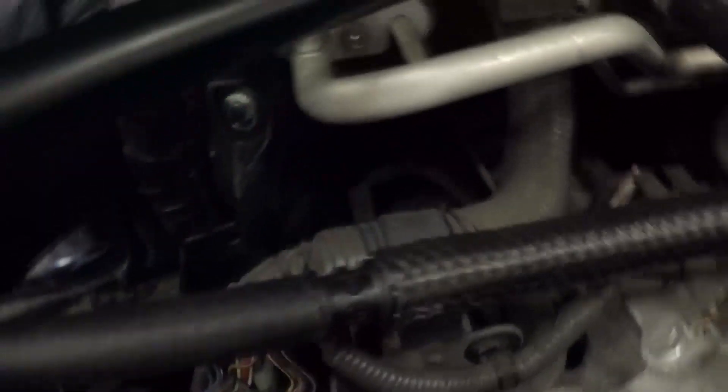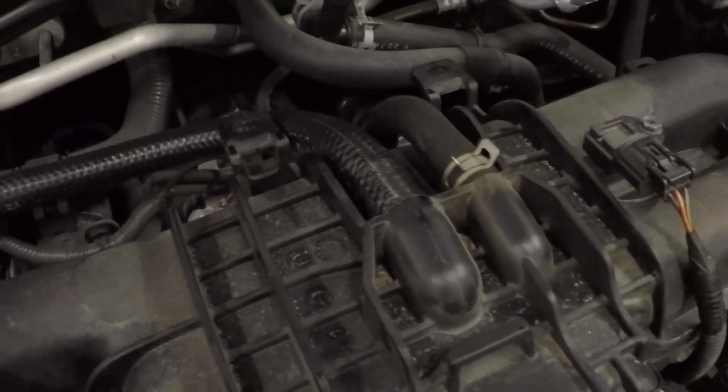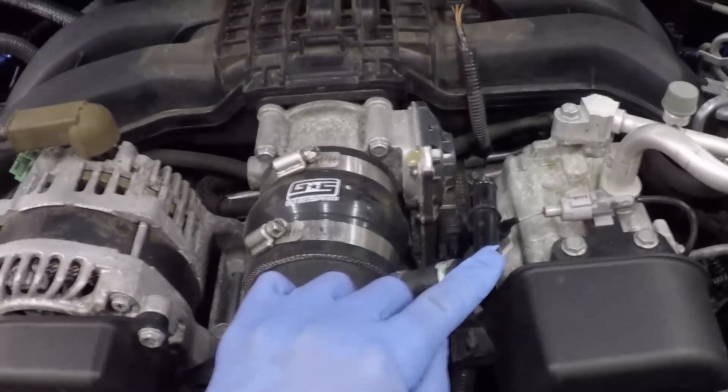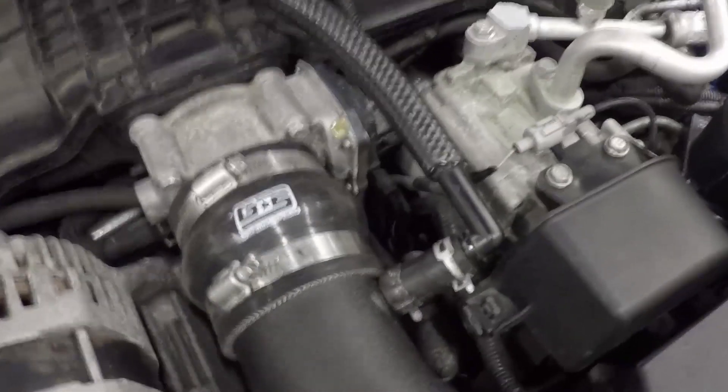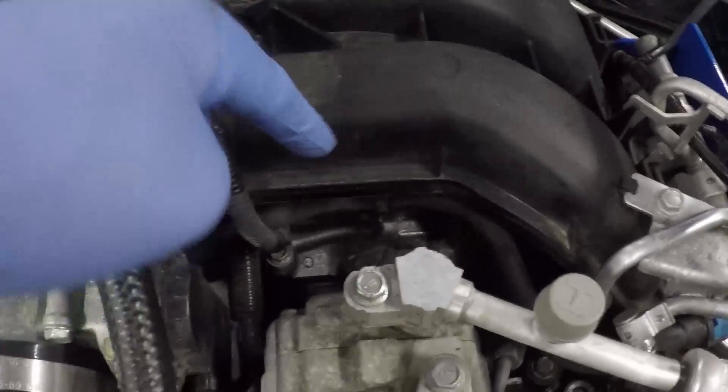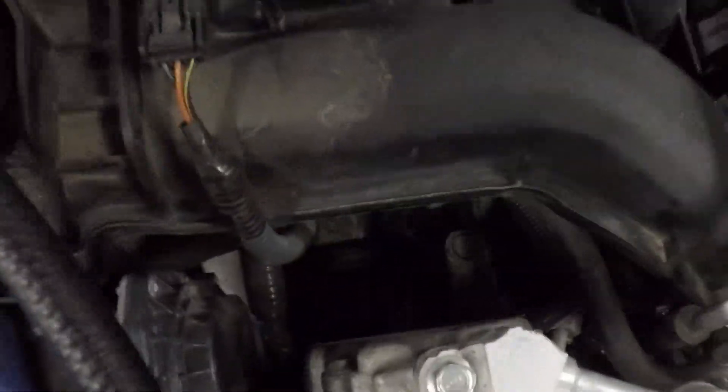The fittings connect with the adapter in the middle, going into the PCV valve and directly into the intake manifold. The third nipple is plumbed all the way across and into the intake inlet tube — route it right over the top of the engine as cleanly as possible. The fourth nipple is plumbed back into the factory location on the engine block, routed over the top.